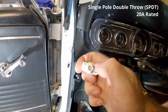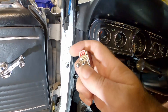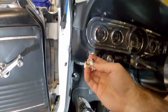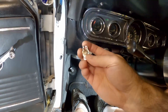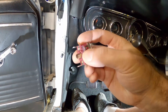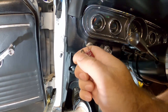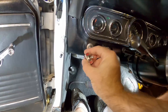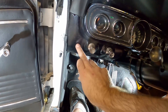There's no middle position, so if it was sitting like this you'd have low beam, then I could flip it up and it would be high beam — just recreating what we've got down there with that switch. The terminals in the back are set up the same way, with a common wire in the middle and then low beam and high beam. It should just replicate what we're doing down there. When I want to put this switch on the dash, I'm going to have to drill a hole.